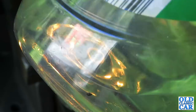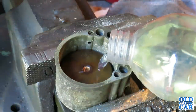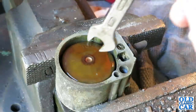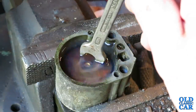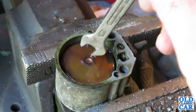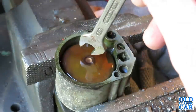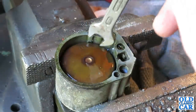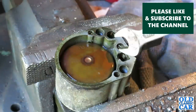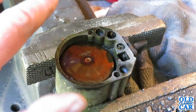I've got my trusty container of fuel so let's pour this in and see whether she floats or sinks. It appears to float — if I push it all the way to the bottom of the float chamber and let go, it floats back to the top. Of course it could still have a leak — a tiny pinhole will take a little while to fill with fuel. So the initial signs are promising but it doesn't prove it doesn't leak at all. I'll leave it for a little while, go and have a cup of coffee, come back, and see if it's still floating.